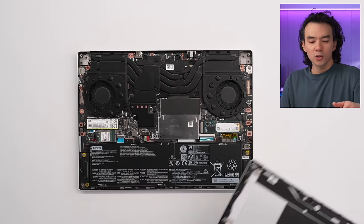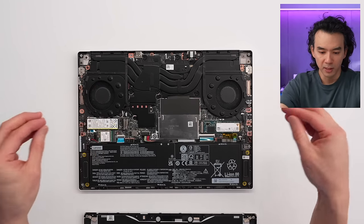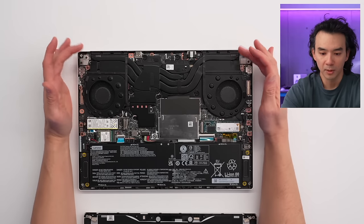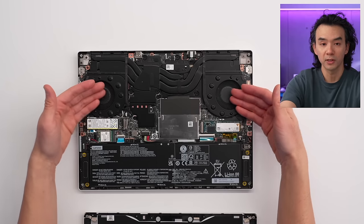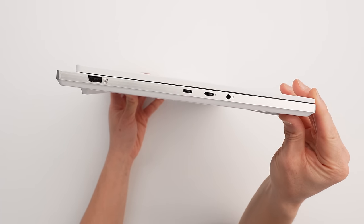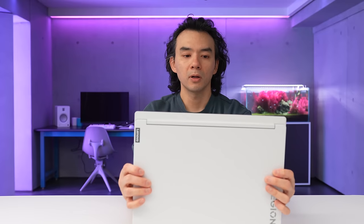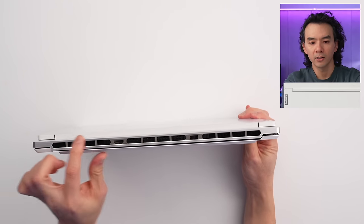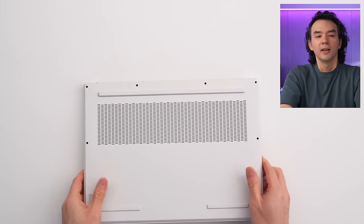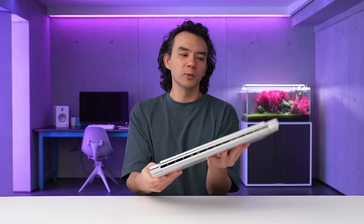The hyperchamber is a sealed-off section that drives airflow in a very particular way. Air comes in through the fans, some blows out the back, but a huge chunk is blown across the middle into the sealed section and then exits out the back. The whole device has no side ventilation — the entire back segment is an exhaust. The difference it makes is surprisingly significant. They've been able to increase wattage and performance while achieving measurably lower temperatures and quieter fans, all in the same form factor and weight class as before. It's really well done.